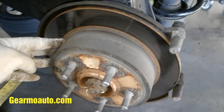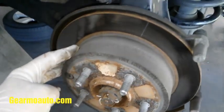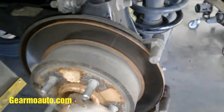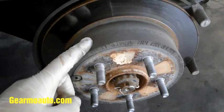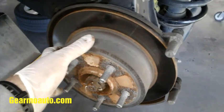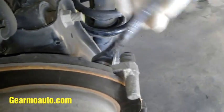I'm not taking the rotor off — this video is just for putting new pads in. I will take this bracket off however to clean it and lube it up, but I'm gonna use the on-car rotor cutter to cut this rotor. You'll have to find a different video for how to get the rotor off. Anyway, we'll go ahead and get this bracket off — there's a 14 millimeter as well, just bust the bolts loose.